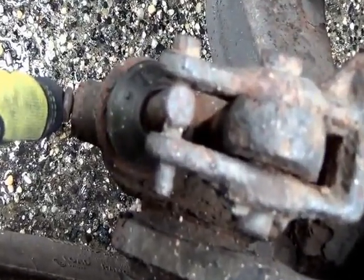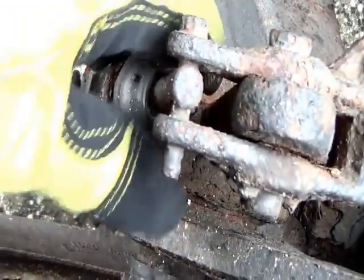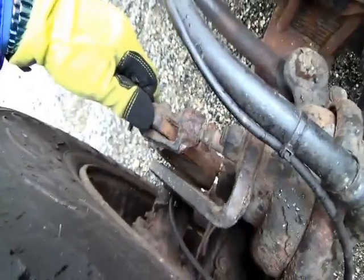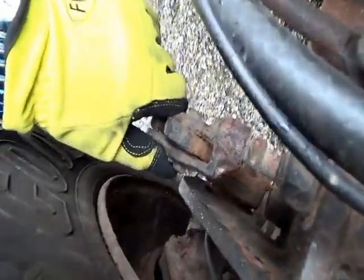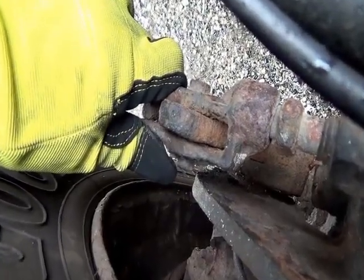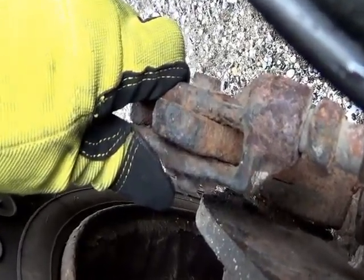No illegal welds. And when you pull on it by hand, this is chapter 11, page 11.3, about the push rod and slack adjuster. When you pull on it by hand, it should not move more than 1 inch. No more than 1 inch.